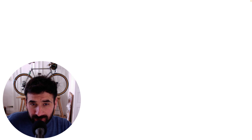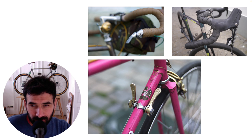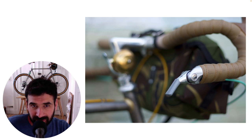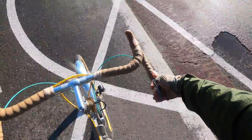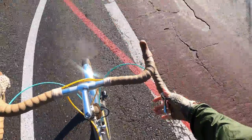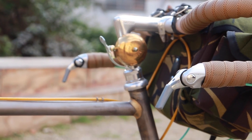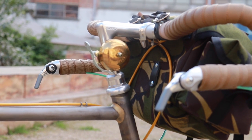For shifters, the options were either downtube shifters, bar-end shifters, or conventional brifters. Downtube shifters are too uncomfortable for me, and brifters would conflict with the classic look of the bike. So I went for bar-end shifters, which are actually pretty easy to use. I tried friction Diacompe first, but friction really doesn't work with 9 speeds at the back — I would often miss the right position and the chain would start jumping, very annoying. So I sent those back and installed these Shimano Dura-Ace bar-end shifters, and they are incredible. I got used to them very quickly — comfortable and efficient.